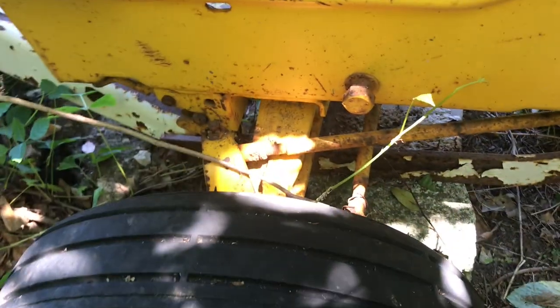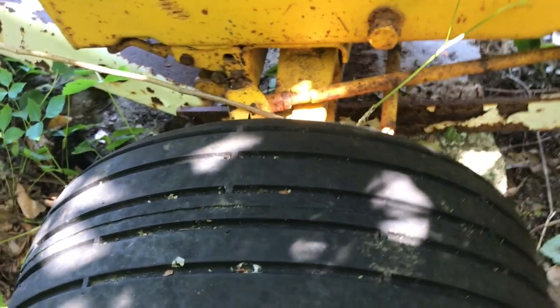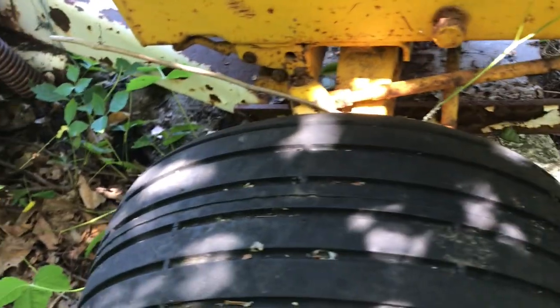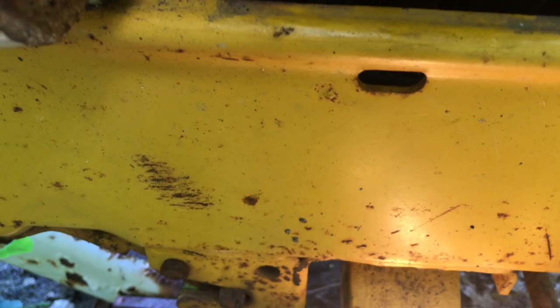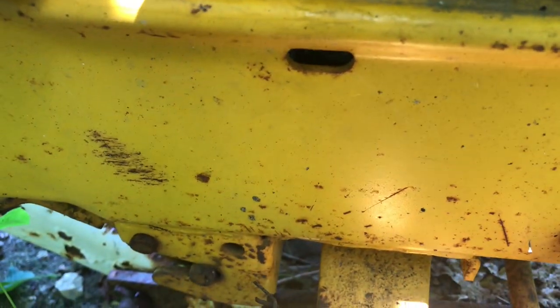So I got my feeler gauges here. And we're gonna find 20 thousandths. I know that's the spec, that's what I've read online, but when you static time, you're gonna be changing the gap as you do it. So just cleaning my tool, hold on. It's got leftover garbage from the last time I did something. Alright, so if I run that in there. It's a little tight, like the thing moves.